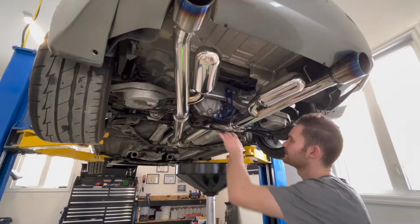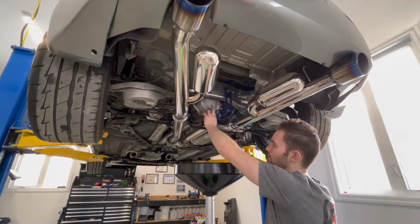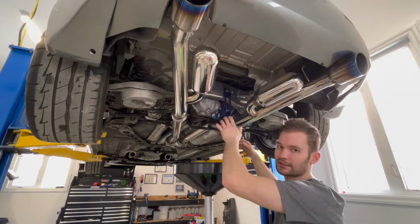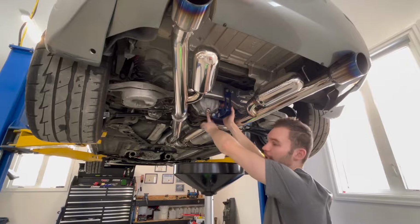It's kind of nice that Nissan actually did this, because a lot of companies and brands don't actually have a drain port on it. They only have a fill plug on it. So normally you have to take the whole cover off, drain it, reseal it, and then that's how you do your diff service. But with this way, we'll just drain it and fill it. We got a side port here and a drain port there.